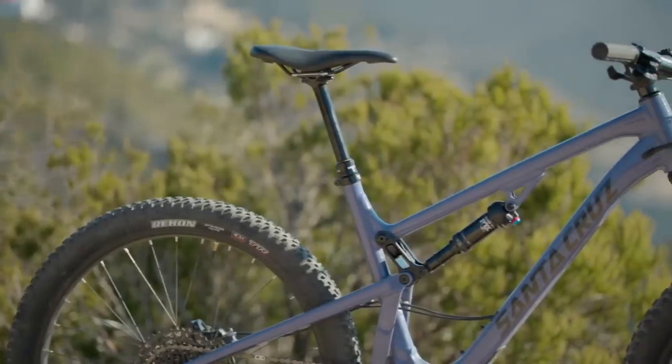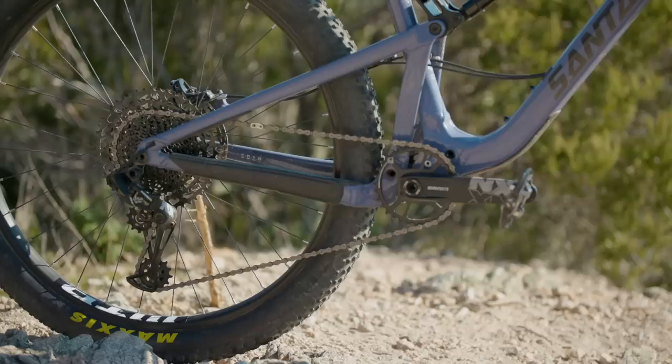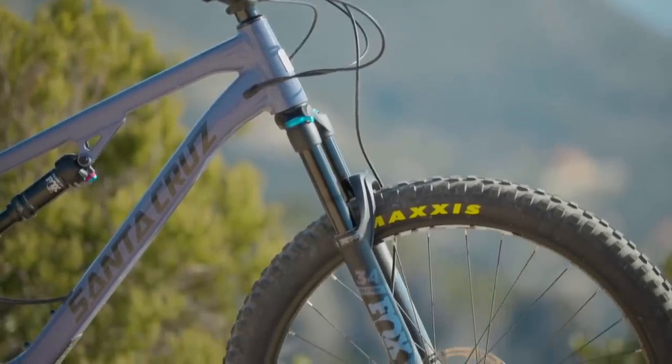In this large frame, in the low setting, you get a 457mm reach with 426mm chainstays, so fairly well balanced, and that is quite a short back end. You also get a 66 degree head angle, which is reasonably slack and pretty much on par for the rest of the bikes in Trail Bike of the Year.